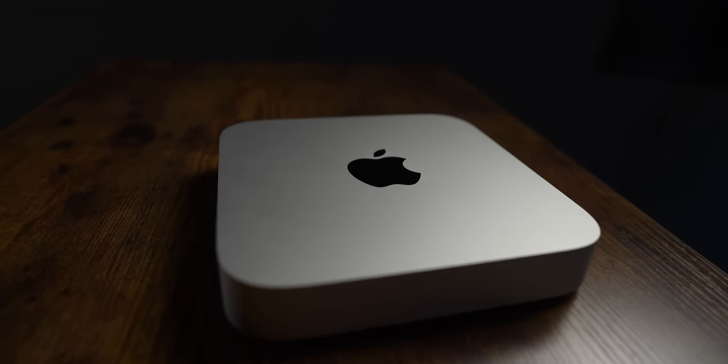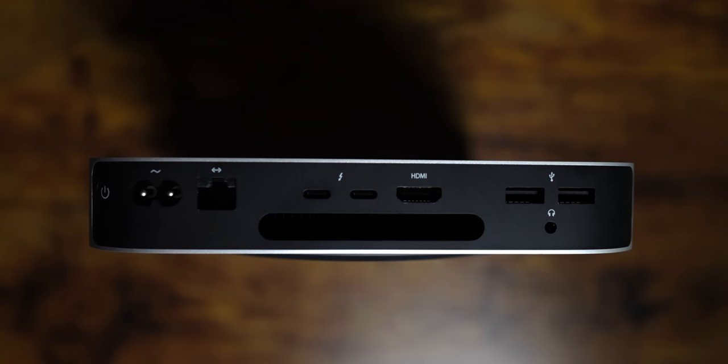Let's talk about this Mac Mini M1. It's a super powerful computer and I'm just running the base model. I'll put a link below in the description to another video all about the M1. What I want to talk about is what I have connected into my M1. On the back you have a bunch of dedicated ports which makes it very easy to build out an editing suite. There are two Thunderbolt ports — one I use for my SSD drive, which is what I edit off of. I'm using a base model Mac Mini so there's not a lot of storage, meaning you're not going to edit from the computer itself. I use a fast SSD drive to edit from. If you got the two-terabyte model, you could just edit straight off the drive and it's going to be super fast. I use one Thunderbolt 3 port for my SSD drive.